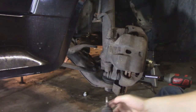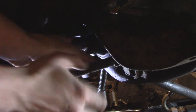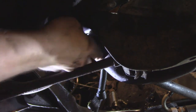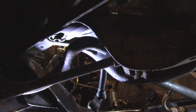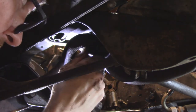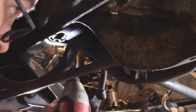In a mystery box on the shelf, I found these bushings for the sway bar. They are just the factory replacement rubber style ones, but it's nice to put new bushings there. Honestly, the polyurethane ones for this — not that important — and replacing them is good. If you ever hear a car that creaks a lot in the turns, that's probably a likely culprit. These things get worn and it's metal on metal, or it's just really old rubber against metal.